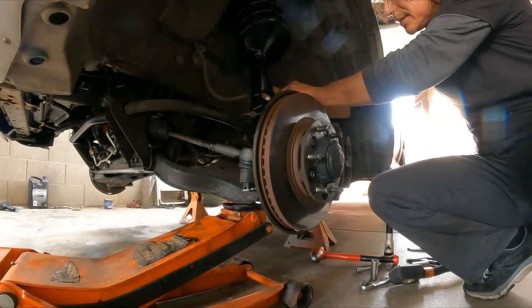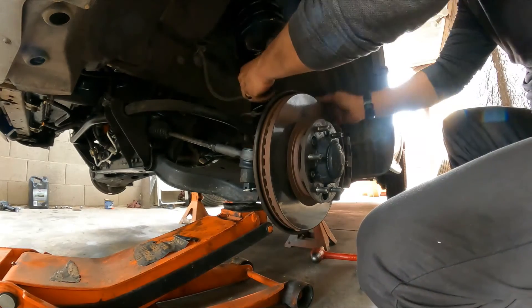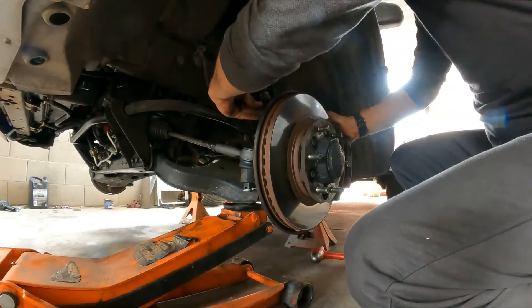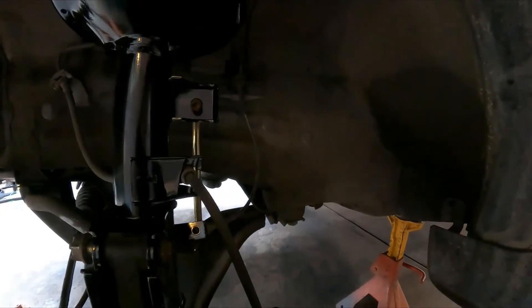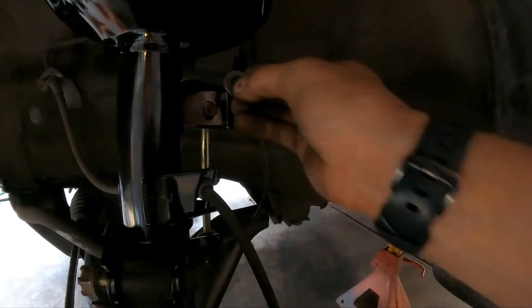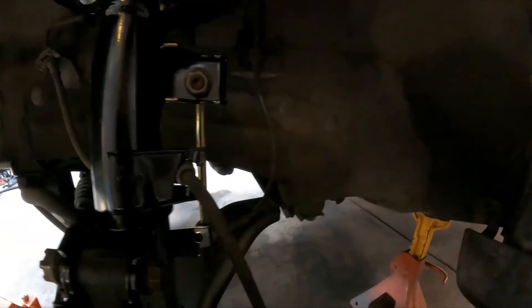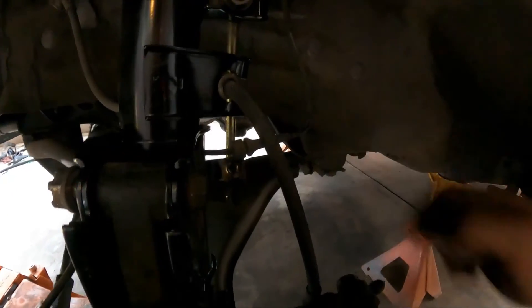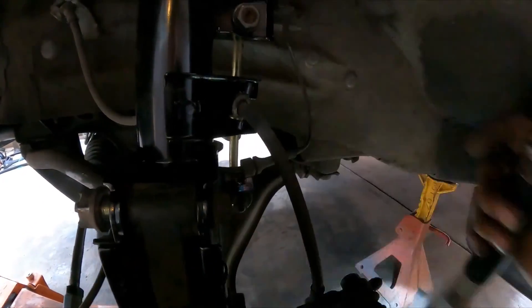The brake line is in again, so we're going to put the two nuts. I'm going to put all the torque specs in the description below so you guys can see them. Speed sensor goes there, it goes there — on this one remember it had a washer, remember to reinstall that. The clip goes here and here. Because the bracket is a little different, we're going to use a zip-tie to tie this part of the speed sensor cable, and that will be pretty much it for this video.